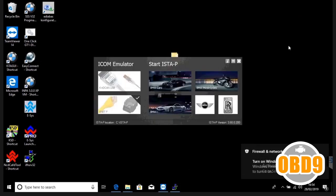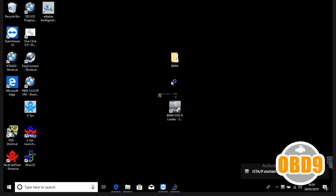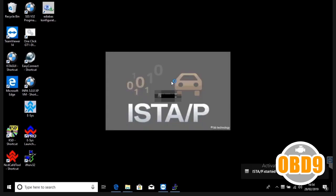You can see the networks are now off — it's going to give you a warning. Now you can simply start the BMW car application. It's going to be about a 5 to 10 minute wait, so I'll be back once it starts to show you exactly how to configure it. While this is loading I'm going to load up ISTA+ and show you the settings you need to use in order to connect an F-series car via ethernet cable in the configuration settings.